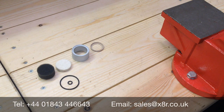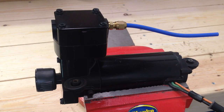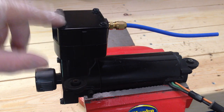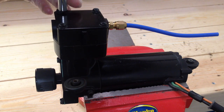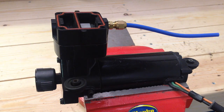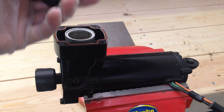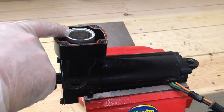I'll now show you how to fit these new parts and how to recondition the compressor. Remove the four head bolts using an 8mm socket — there's also a Torx head on these bolts, but we recommend using a socket instead as the bolting is quite soft. Lift off the two parts of the head. Inside this part of the head, there's an O-ring.